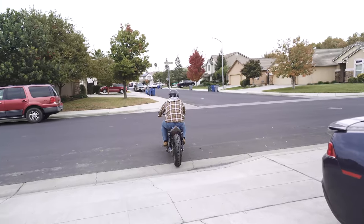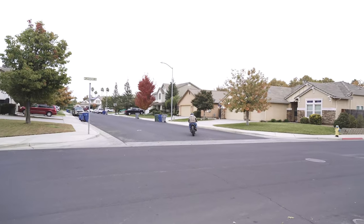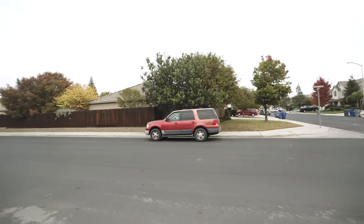All right, so he's taking it on that test run. While he's gone, I'll just summarize what we did. We did the high frame rate stuff. The wheel spun 36 times in 1 second. He did the math. The math wasn't really lining up with the gearing and how many rotations the tire made, but he definitely found that we needed a larger rear sprocket. Right now, he's just testing it out. We did turn regen off as well.